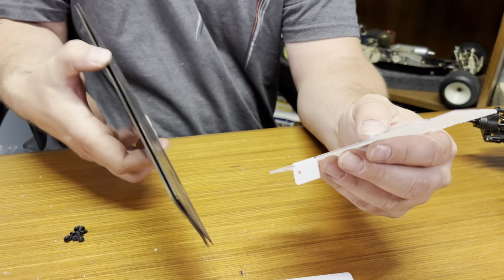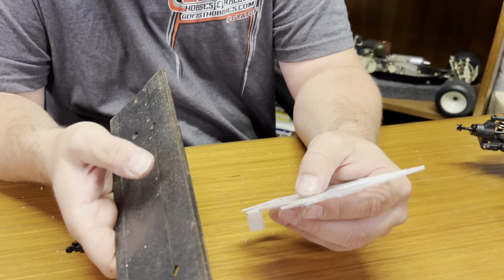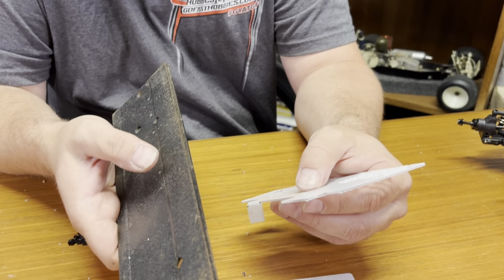This is a sheet metal brake. It's used for duct work. You can buy this at Menards. Same thing with this one. Don't want to use this thing to fold it all the way around because you'll snap it off. Just start bending it with it. Stop. Use your finger underneath it. Push like this. Fold that tab over. Okay.